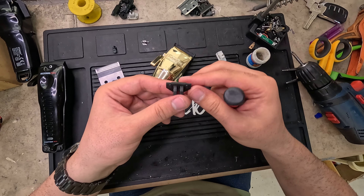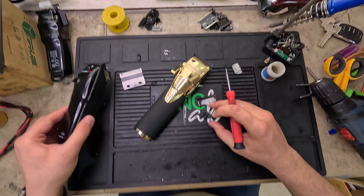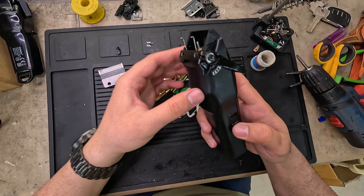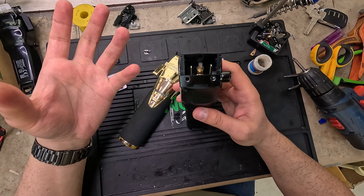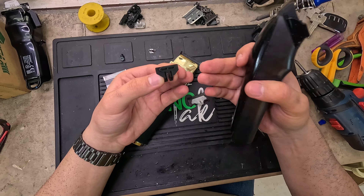If you are a manufacturer that wants to use this pin drive, you should keep the RPM of your clipper low. The problem with this clipper, in addition to its design, is a high RPM. The motor has a high RPM so the pin drive can't handle both the speed and the friction, and it gets damaged very soon.